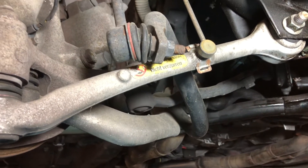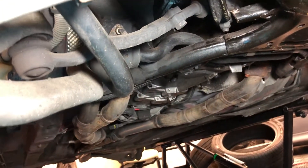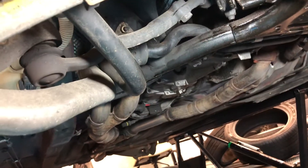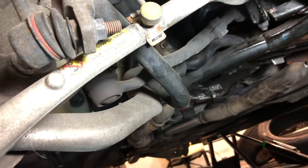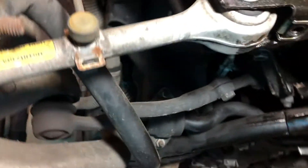By trimming this off a little bit we are pretty much at the limits of what the stock suspension will do. You can see these arms are all pretty tangled up and very close to each other — the sway bar is quite close to the thrust arm, the thrust arm is close to the tie rod, the control arm — I mean everything, it's just a tight setup.